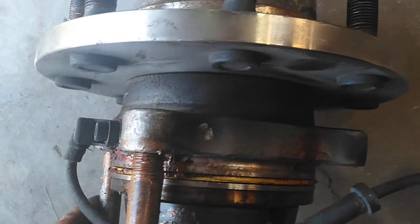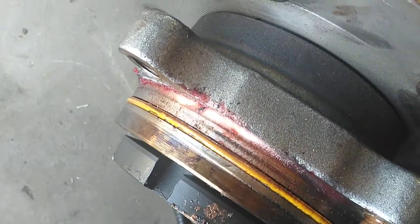Look at this - here's the wheel bearing. Look at all the heat marks. Can you see that? That's crazy. And this puppy's hard to turn too. Look at the heat marks - oh my God. Going down the highway at 70 miles an hour, this thing was going crazy. I'm like a Tasmanian devil in the passenger seat. That's junk. I've already talked to Napa - they got one set aside for me. I'm upgrading from a premium to a platinum model. This truck keeps eating wheel bearings on this side for some reason, and I know it's not an alignment problem. It needs leaf springs but I wouldn't think that would cause the wheel bearing to go out.